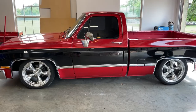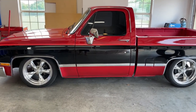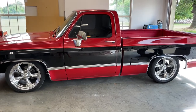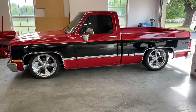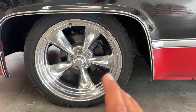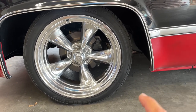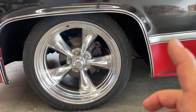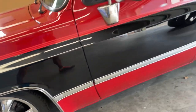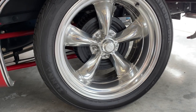We're done with these wheels and tires. I know a lot of people love the look of these Torque Thrust 2s — Torque Thrusts in general have been around a long time, it's a classic style. But for us it just doesn't fit the style of this truck. Because this cam hits like a drunk stepdad, it's got such a muscle truck feel. I do have a buyer for them so they're already sold. These are 245/40/20s and we're going to switch to a 245/45/20 in the front for more sidewall, and stay with a 315/35/20 in the rear.